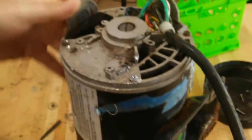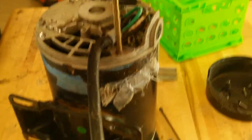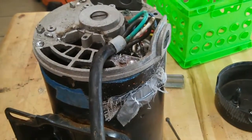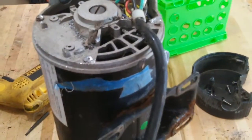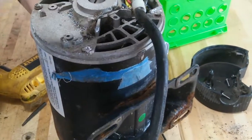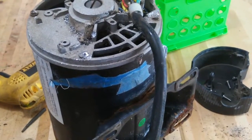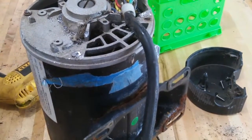That was hot too — look at that. Do not put your hands on the hot metal. So what we're going to have to do now is just keep pounding them out and keep drilling. It's going to take a little bit of work, as you can see. The through bolts are just stuck in there. This is how you remove the through bolts — it's an extremely painstaking process, little by little. I'm going to take my center punch once again and we're just going to continue the process until we eventually remove all the through bolts.